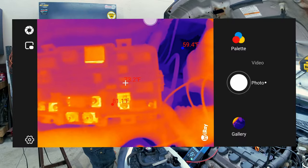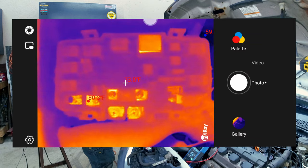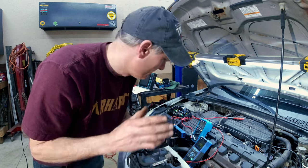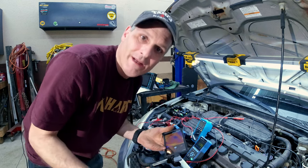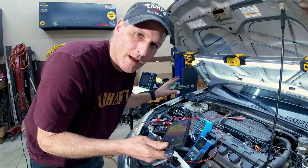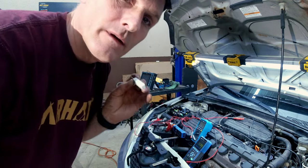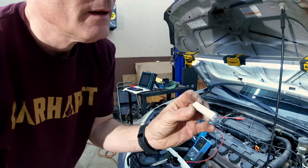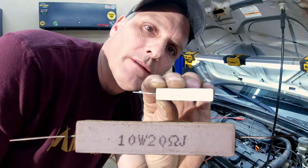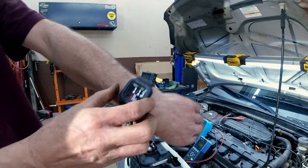I went and got a 91-ohm, 5-watt resistor — should be about 138 milliamps, plus the baseline seven, so around 140. We're showing 143 on this meter and 135 on the other. It is now 1:09, about one-and-a-half hours in. I had it on a battery maintainer, which is why voltage is a little high. We're still not seeing that fuse warm up on the infrared camera — it's almost the same temperature as the rest of the fuses. Now we have a 10-watt 20-ohm resistor; doing the math we're looking at about 630 milliamps.